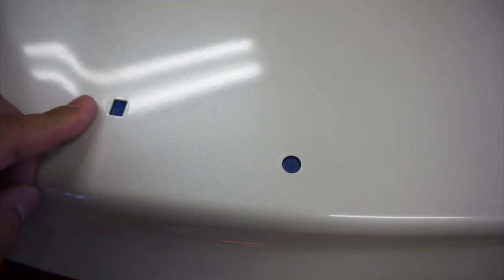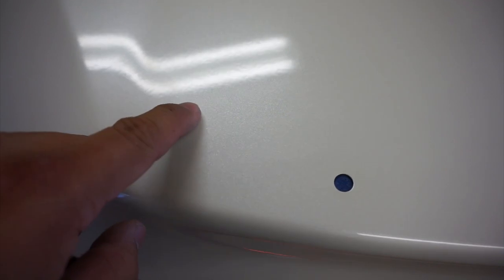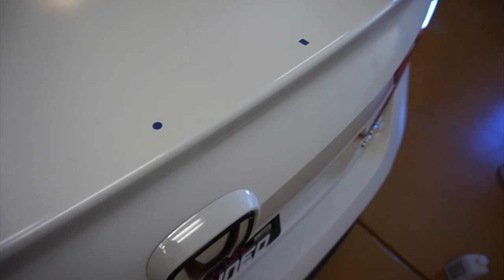At this point it's trial and error. I showed you the existing holes in the trunk. My thought is how do I get the expanding foam in there to create a seal on top and bottom without it spilling everywhere inside the trunk? What I did was put painters tape on the inside and give it a small push so it creates just a small hole. I'm just going to put a little bit of foam in there — my hope is the foam will get a little bit behind there and spill out the top enough for me to sand it.